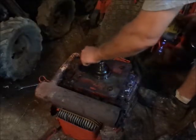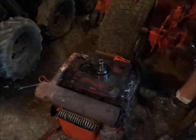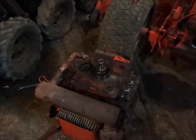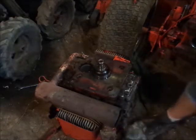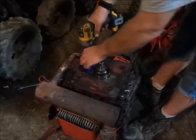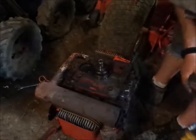And this one bolt on the adapter plates are special, and I don't have my 3/8 bit. I do over here though. Oh, I just saw it. There it is. Okay, this is a 3/8 Allen headed bit because of how close it is to the machined hole for the PTO clutch and the adapter plate. So I'm going to lay all the bolts down there.